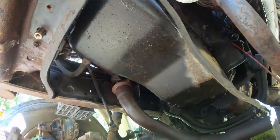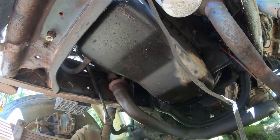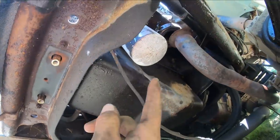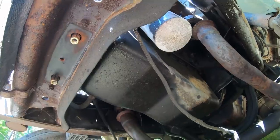The engine I'm going to pick up doesn't have that, so we'll probably have to switch to this oil pan. I might as well drain the oil now and pop the filter off — that'll make it easier for clearance on this crossmember when I pull the engine anyway.